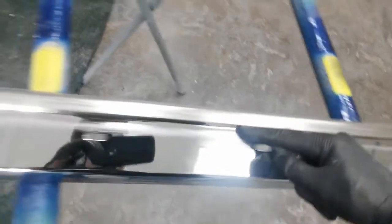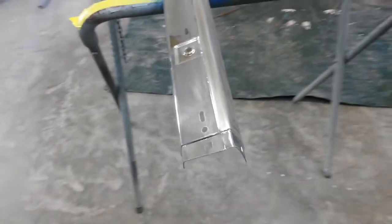I'm starting on the steel parts of the bumpers. The customer decided to buy new parts and all we could get was chrome, so I'm going through with 80 grit taking most of the gloss off that I can, and the rest by hand with 80. I really only need to get paint to this edge, so I'm sanding down to that edge all the way around to the back — that section there, then the end pieces, same thing. There are some little caps that go over this; I may end up reusing the old ones. They're aluminum so they're not corroded like the steel parts were.